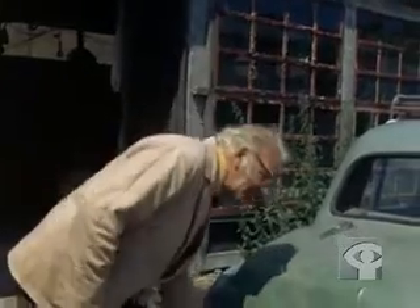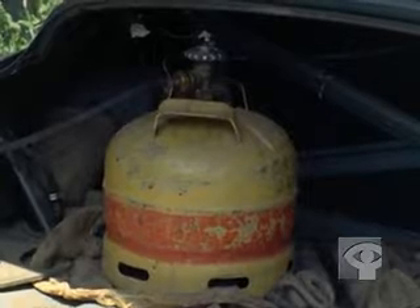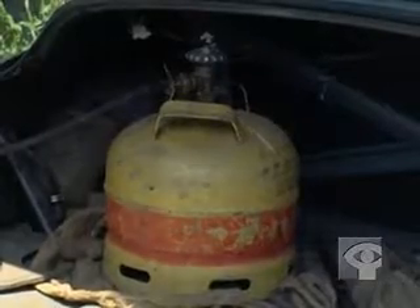I'll show you the gas bottle that supplies the engine with methane gas. This small bottle I use on this car contains the equivalent of about three gallons of gasoline, but you actually get more mileage on gas than you do on gasoline. This is connected via a tube underneath the car up to the converter under the bonnet, and that supplies the gas into the carburetor so that you can switch from gas, petrol, or diesel oil — whatever you're using — as you're going along without getting out of the car.